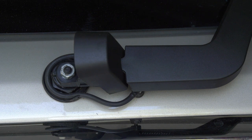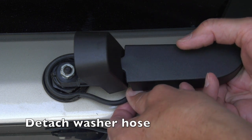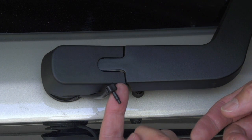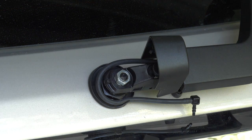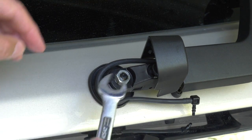Next thing you'll need to do to remove the arm is to jimmy out the washer hose, which comes out like this. There's a little fitting on it like that. Next you have to remove the bolt. Before that, I typically recommend putting a little bit of lube on just to make it easier. This one is fairly in good shape; the GMC Suburban was a little tougher. Taking our half-inch wrench, break the bolt.